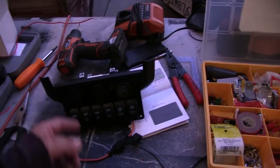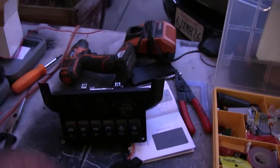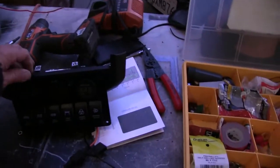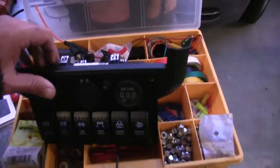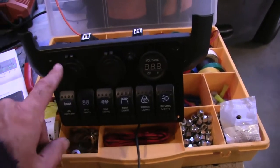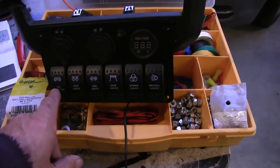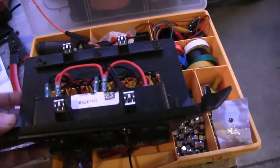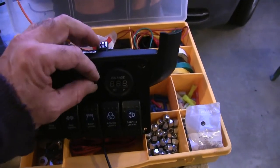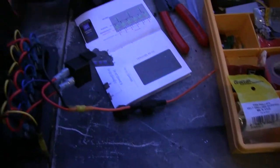I don't need all this stuff powered up 24 hours. So I put a switch on there to control everything. When I hit the switch, the volt meter should come on, and everything else is lit up — everything's hot. I got my USB ports, my 12-volt power port, cigarette lighter, all my lights. So I had to add a little tiny switch — this is from Super Bright LEDs, it came with those lights I bought — and then I had to add a fuse and a relay.